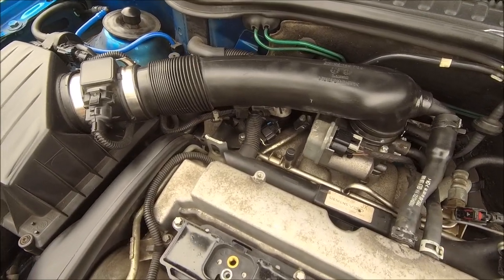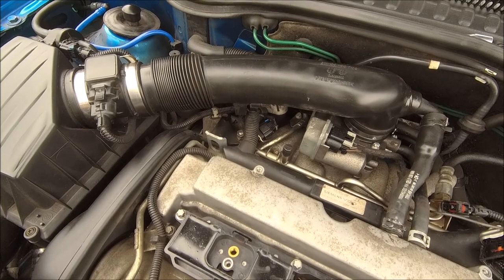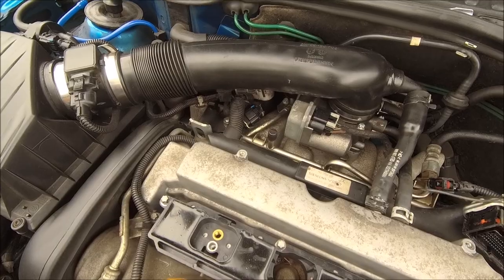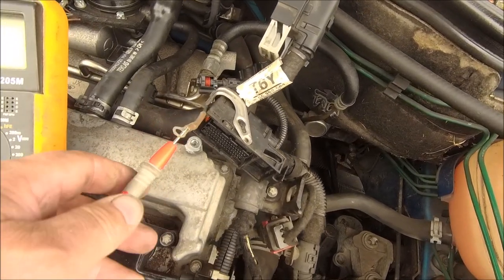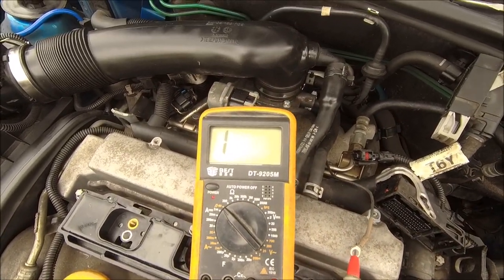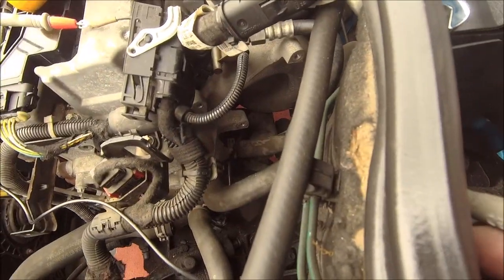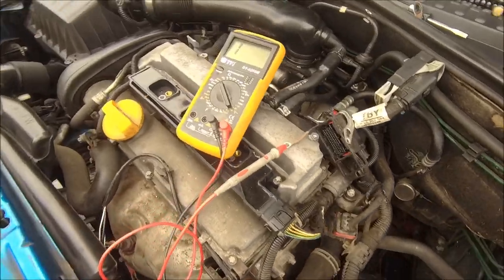I want to try and see if I can get to the crankshaft and cam position sensors to check those are working okay. The annoying thing is nothing is coming up on the scanner at all - nothing - but it's running terribly so something's wrong. Let's do a quick test. I've got the ECU off so it's easier one-handed. There's an earth that goes to the ECU and that's the battery - all looks good. I'm going to check that bolt in there too, apparently that one can be a bit dodgy.